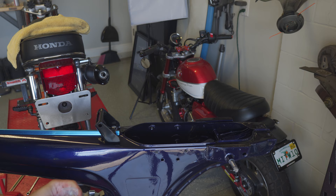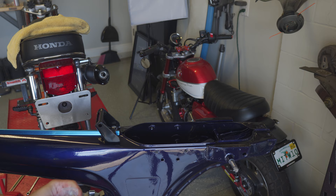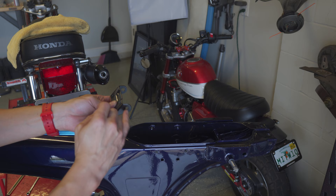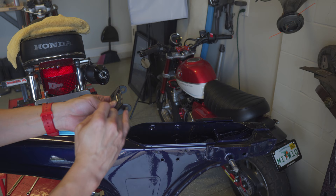You really do need to buy the Honda bolt that goes through this instead of just a bolt you'd pick up from Ace Hardware, because the outside diameter is pretty wide and then it necks down, and there's only one way it can go through. You can see that the hole on one side is wider to accommodate the shaft of the rod, and then the smaller side only supports the threaded portion of the bolt.